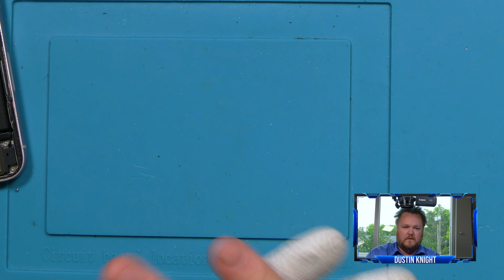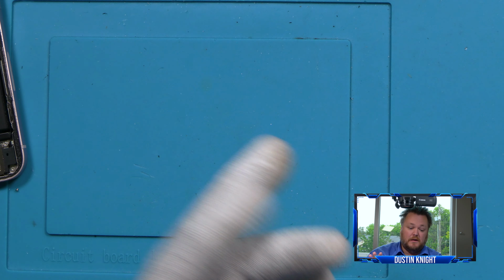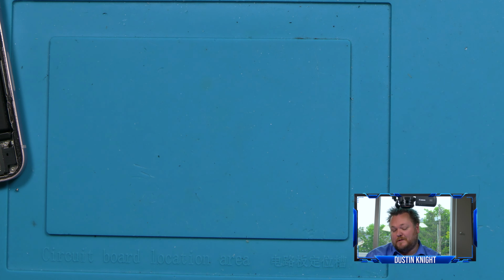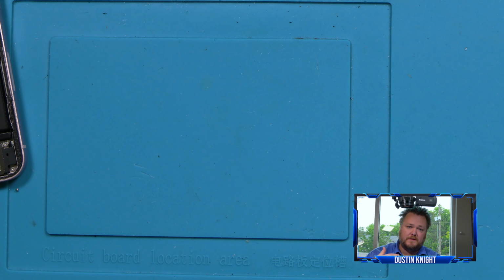It's fine. Remember, if your OLED's good, you probably don't want to go above 80, 90 max Celsius, because you'll burn the OLED and then you don't have a good screen to give back to Mobile Centrics or Injured Gadgets or whoever you sell your parts to.